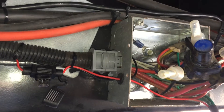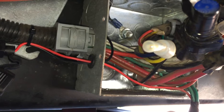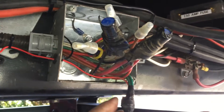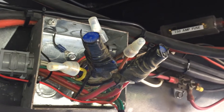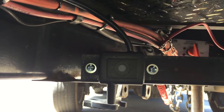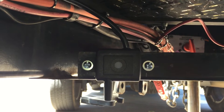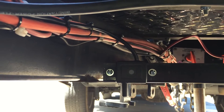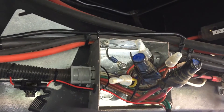This should work pretty good. The reason I connected it to the trailer tow wires is so it will only be on while my running lights are on, which I have on all the time when I'm driving. If I just hooked it up to the battery, it would be running all the time and drawing down juice. I'm going to put the cover back on here and then give it a shot and see how it works.